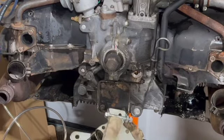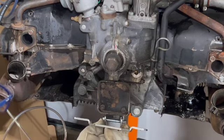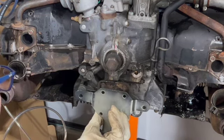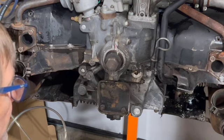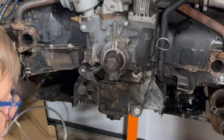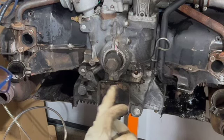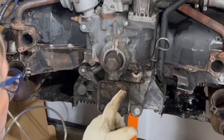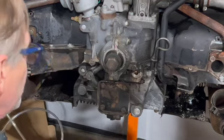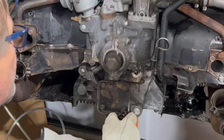And then this U-shape that you see here is going to be attached here in the bottom, and then this is going to become the plate. Now, in between this, we're going to substitute this plate for another plate that is going to be sandwiched in between these 2 plates. But before we can do that, we will have to replace these studs right here for longer studs. So I got my oil pan right there. Notice how loosely that came out.